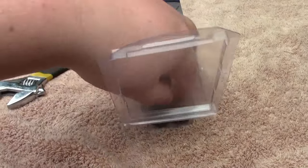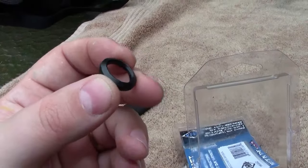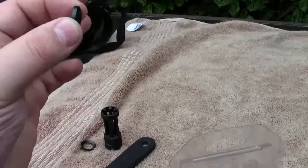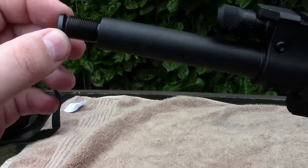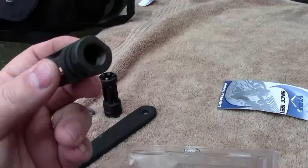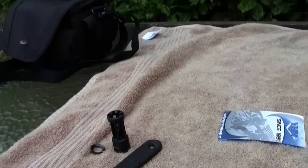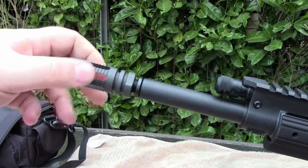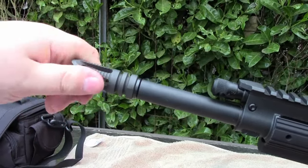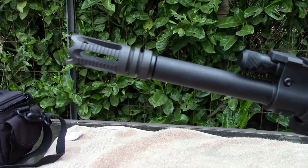Now in the box, they actually give you a crush washer. How you want to install it — as you can see, they have a little bevel, and that actually needs to go on just like so. According to their website, this thing is already indexed for you — it only goes on one way, and it only threads on one way. Go ahead and put that on there and start threading it on. Do not apply too much pressure when you go to tighten this down; it doesn't need that much. But you do want to definitely replace the crush washer, and then take your crescent wrench and tighten that guy down.